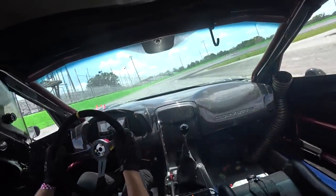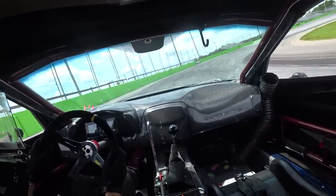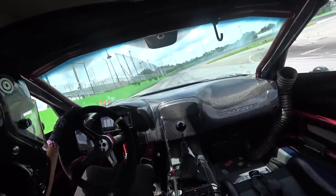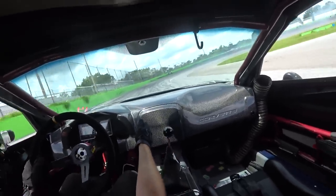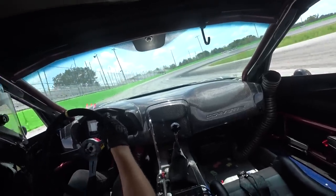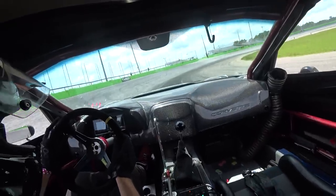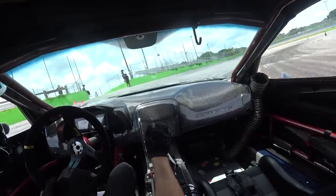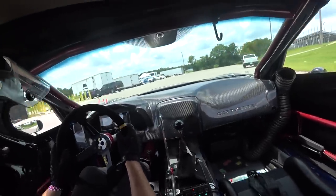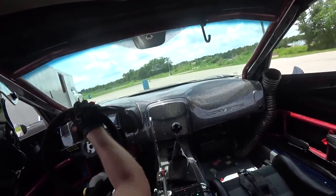So I really didn't want to end the day and waste this new set of tires with these weak bank runs. So I was trying to get at least one good wall ride bank run, but the clutch was not cooperating. As soon as I got after it, it would just slip like crazy. At this point, as soon as I gave it any bit of throttle in third gear, the clutch would just light off, the car would go straight to rev limiter, and I confirmed that it was the clutch slipping by doing a little bit of foot brake to load it up down the straight, giving it a little throttle, and it just zinged right up. So the clutch is for sure smoked. We've got to replace it. But the skid pad's not as harsh, so maybe we'll let it cool down and try to go do some fun cinder laps over there.